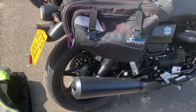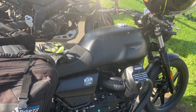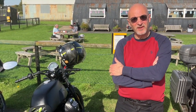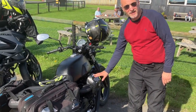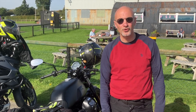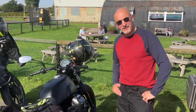It's got Michelin Road Classic tyres as standard. It's got a 900-mile running-in period, so I should be booking it in for its first service probably tomorrow. During the run-in it gives about 70-75 mph top speed, but it's 900 miles. On the first service, the oil is going to be changed and also the valve clearance is checked. That would be a big deal on most overhead cam bikes, but because this is overhead valve, it's quite an easy job - I reckon I could do the valves in under an hour.